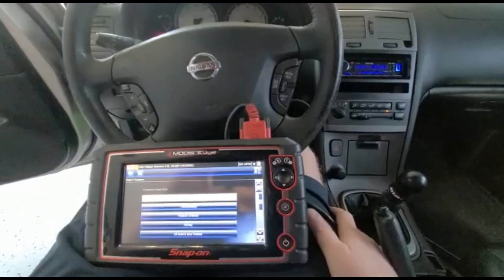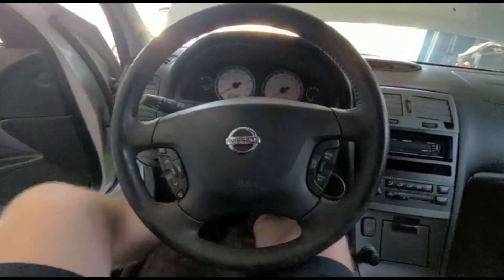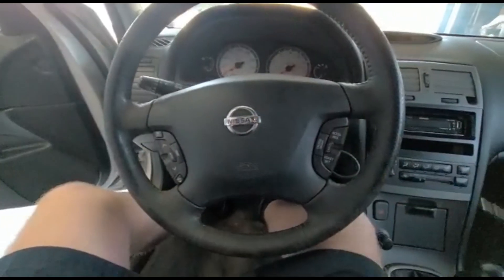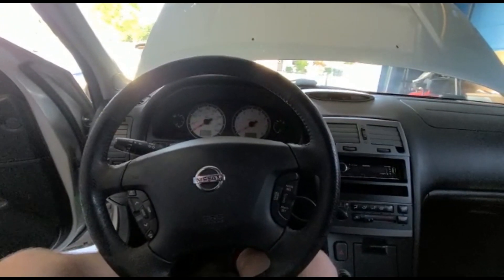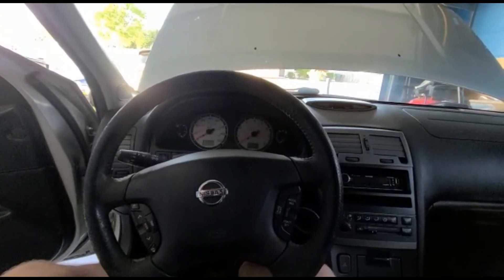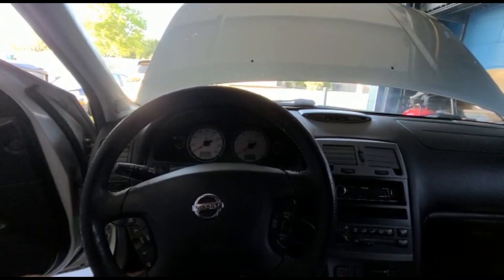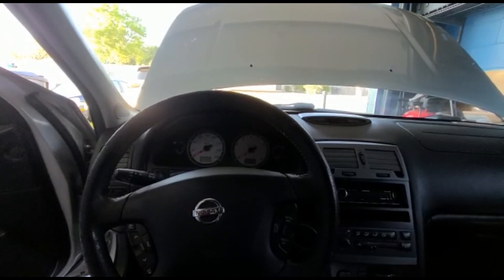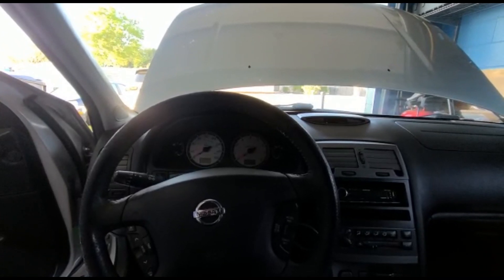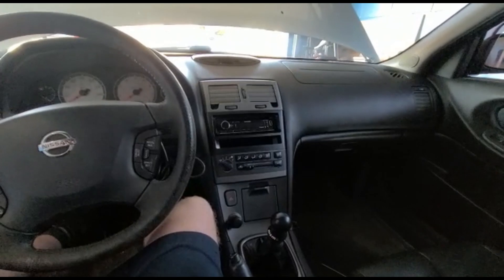When Nelson and I were putting the car together we just overlooked it — no real excuse. It's apparently a big problem with everybody. Darren already has that information on Nesformance — look it up. He has all the specs, the how-to's, everything explains how to put the trigger wheel in. You want to use the factory notch for the cam — don't put it on the other side. Just use the factory notch and you should be fine, and he has wiring diagrams for those too.